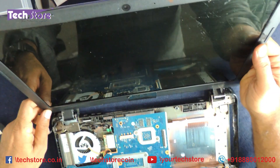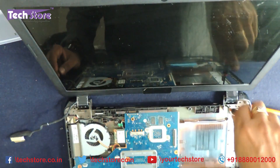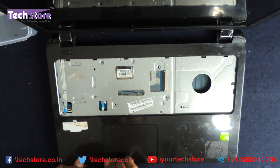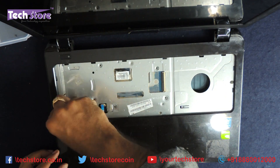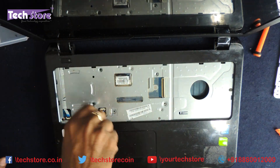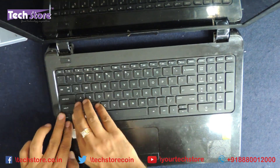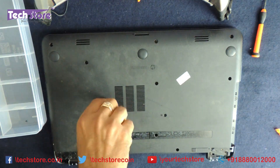Now fit the display back onto the base and put the screws back in — the small one goes here and the big ones in their respective positions. Put the VGA cable back in. Take the touchpad and refit it, fixing the power button and touchpad in place. Put the touchpad screws back. Take the keyboard, press it into place, and once fitted, flip the laptop and fit all the screws that were removed.